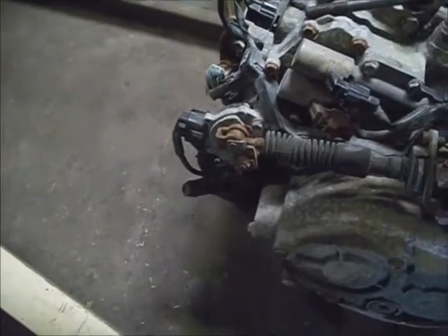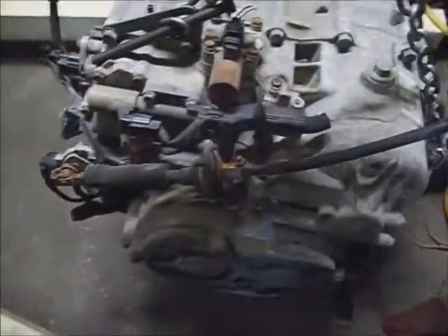You got to look for that stuff when you buy a used transmission. This one is not supposed to be leaking fluid, but it is wet on the front of it. A wet place is a good place to start checking for cracks in the case. I think the drain bolt is just loose on this one, so it's probably not going to be an issue. Looks like it's been sitting outside for a while.